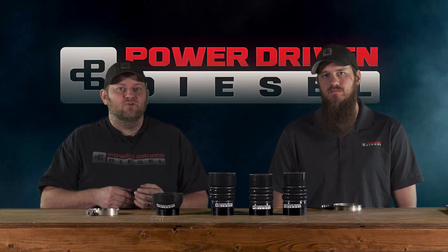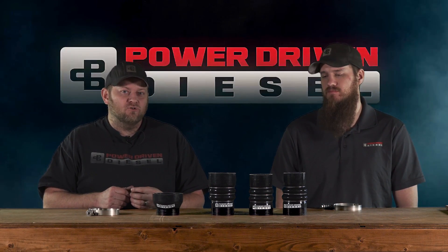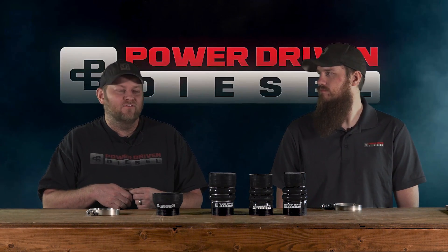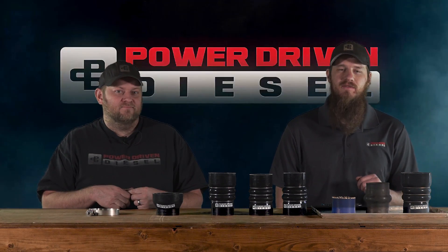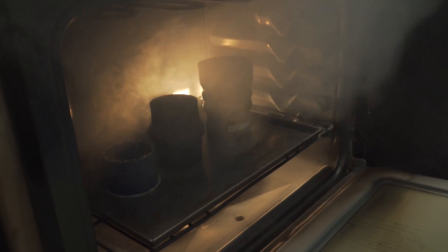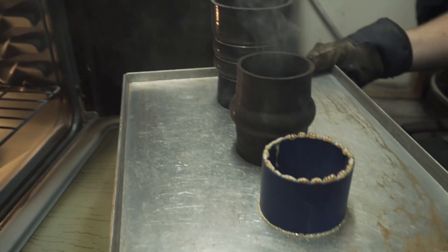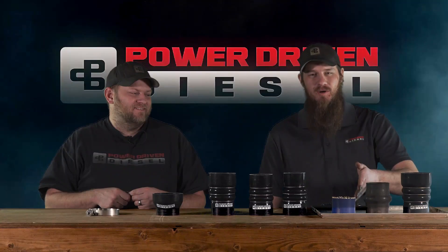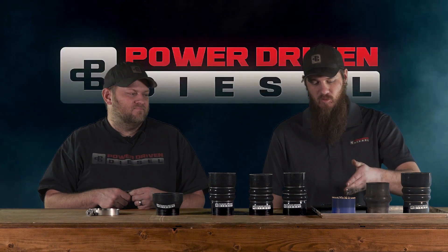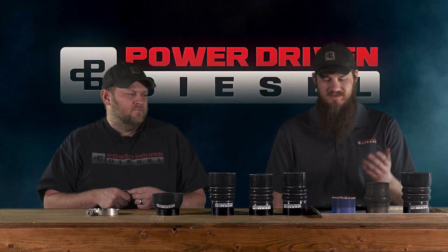We've had a lot of fun developing these boots, playing with different brands of boot — factory and otherwise — in the toaster oven and convection oven that we have. What do you got over there for us? So these were at 550 degrees Fahrenheit for about 20 minutes. This, as you can see, is no bueno. This looks like someone did spray insulation foam on it — it literally roasted like a marshmallow in there. This is a four-ply polyester boot from eBay, and yeah, it's just gone — it went through the elastic state.